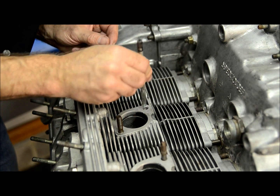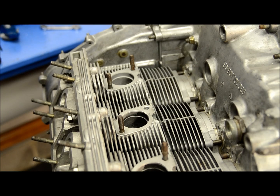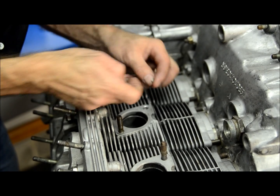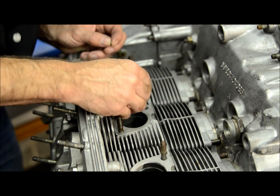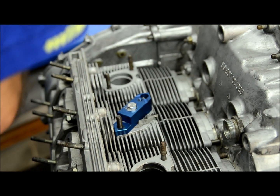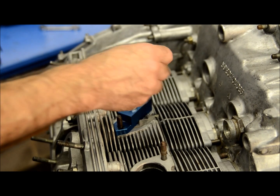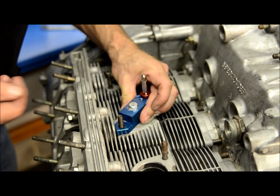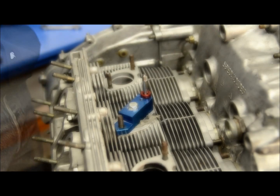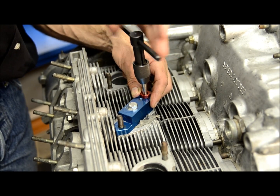There's a little bit of shrapnel, and here's the remaining bit of the tip of the stud. Now, just to clean up the hole — you don't have to do this, but you might want to chase the hole if you need to. In order to do that, you can come along, put in the red bushing, and that's your guide for the tap. You probably don't need to have everything as secure to chase the threads as you would with a bit.